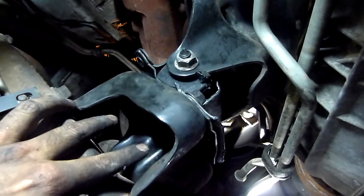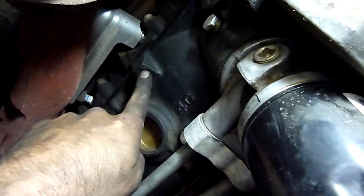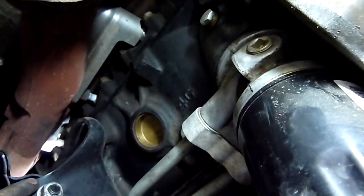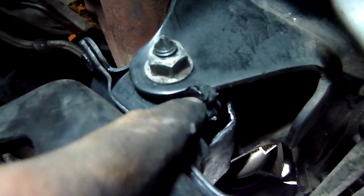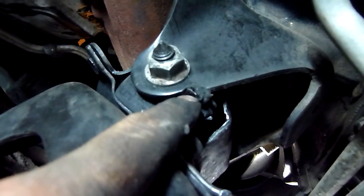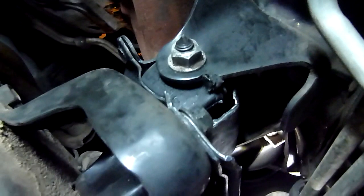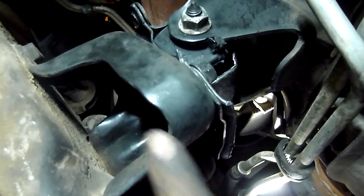You access the bolts through here, then open this nut up and jack up the engine. You jack up by putting a 2x4 up to this point right here, lift up ever so slightly, pull this bolt out, then jack up as far as you can and the mount will drop down and out. There is a lip on this engine mount, similar to the other side, and it is towards the inside of the car, not the outside. When installing the mounts, do not feed them from the top down — instead feed them from the bottom up.